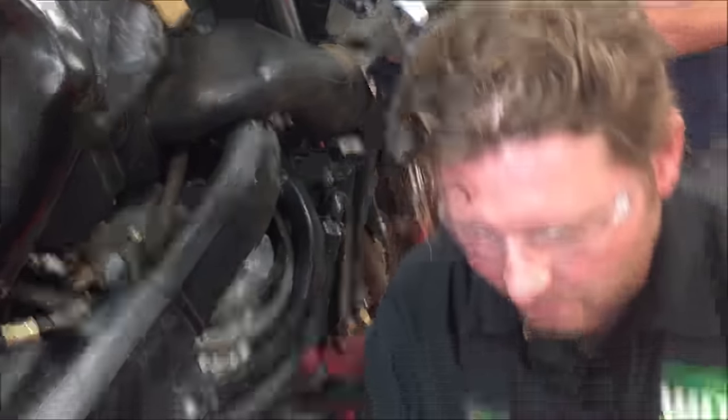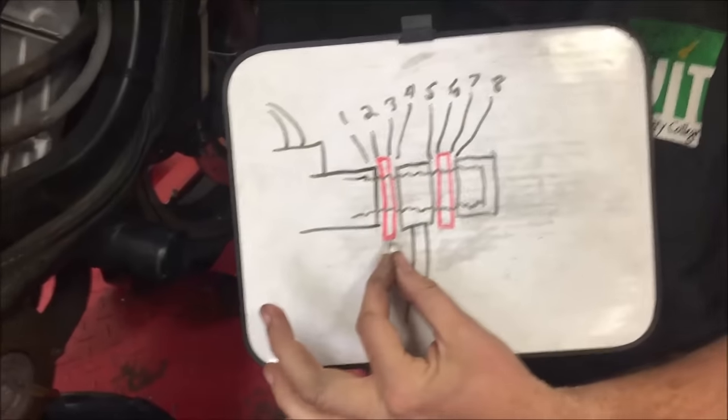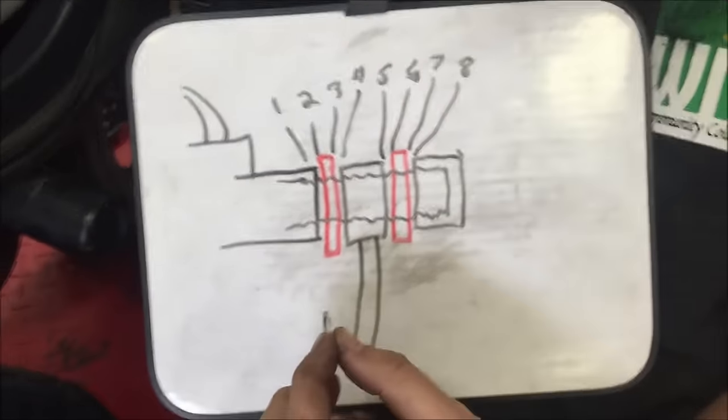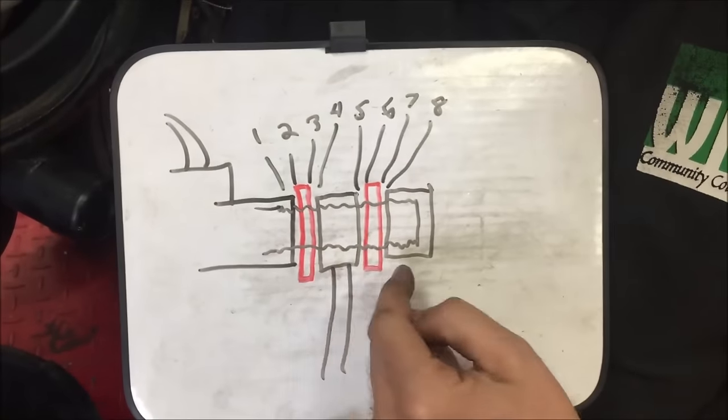But here's the every-mechanic part that's overlooked. When people put new washers in, it seems really easy — okay, I'll just put new washers in — and you can still end up with a leak. I want you to think about this for a second: there are actually eight sealing surfaces on any banjo fitting.